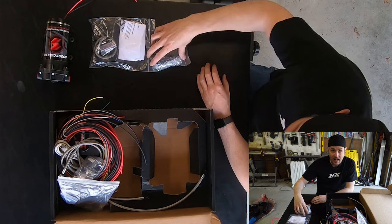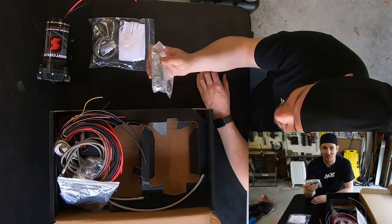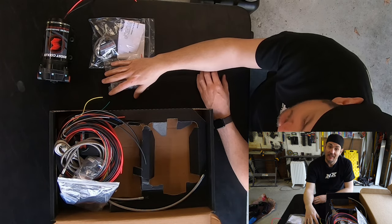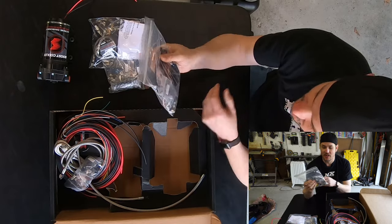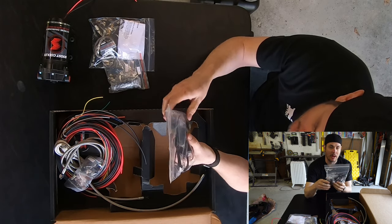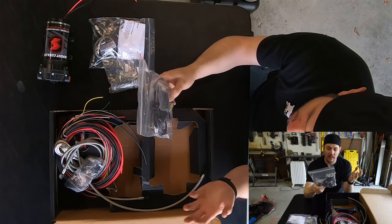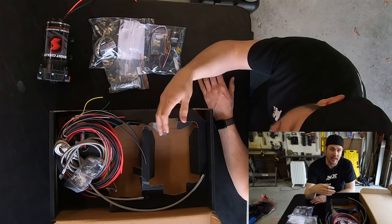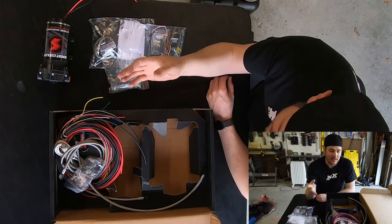We've got a nice inline filter to keep everything clean — got to have that. A lot of people don't run that stuff, but it's way too easy to get something in your line and clog your nozzle. Then you can have an issue under boost if you're not delivering that injection. We also have our level sensor to install into the tank and our other nozzle. The level sensor is very important — we want to make sure whenever we're running low we have some overhead. It comes with an LED so you can put it in your dash to give you an indication you're running low on fluid. And there are other features through the controller itself to control things like waste gates, limit boost, or cut timing.